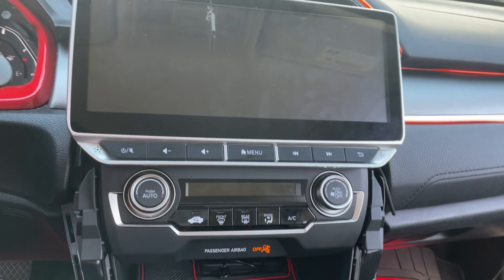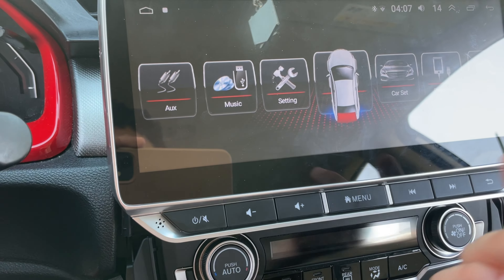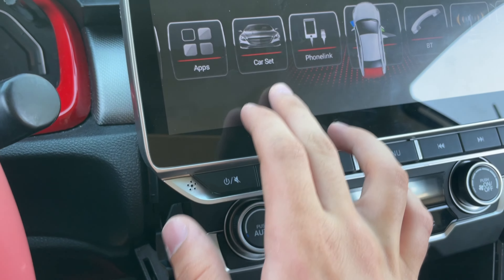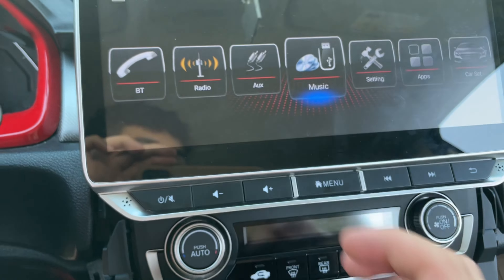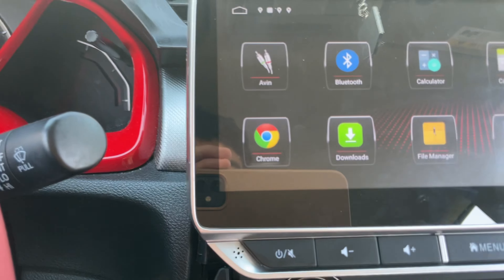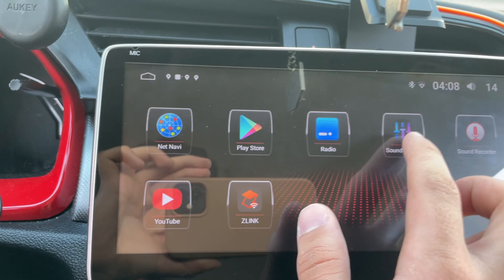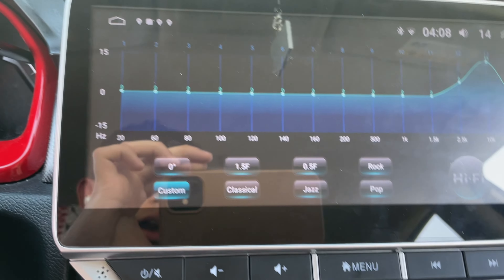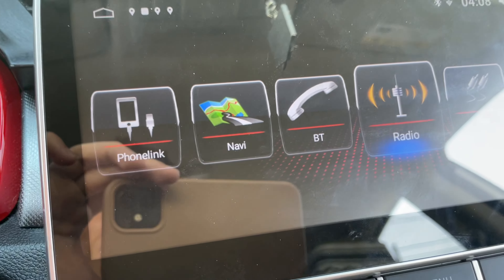We have the screen fully functioning — it shows which doors are open and whether the trunk is open. Go ahead and connect your phone to Bluetooth through settings. The music sound quality did bother me at first — it sounded cloudy, and with a car that's what you're doing most of the time. The fix is to go into sound effects, turn off Hi-Fi, and set it to custom. That should fix most of the issues with the sound system.